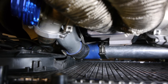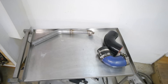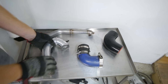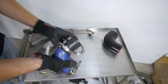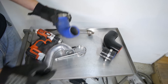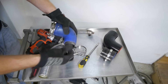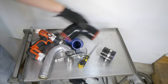Next, we'll get to the intercooler piping. I didn't have the right elbow when it was time to leave Willy's shop, so I had to make do. This blue elbow was meant to fit the J-pipe, which is quite a bit smaller than the outlet on the HX35. So I had an extra two-and-a-quarter inch coupler that we coupled onto the outside, and Willy cut off a piece of pipe to strengthen the inside so we could clamp it tight enough to avoid boost leaks on the way home. Now let's go ahead and put the proper size one back on.